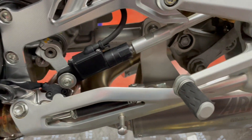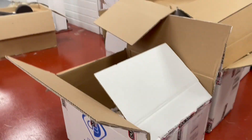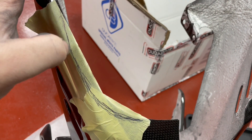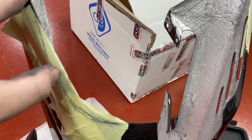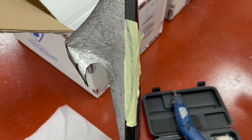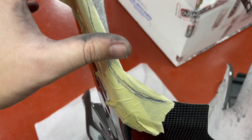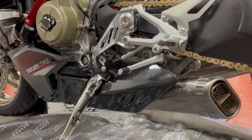We're going to attempt to fit it now — hopefully it'll go on nice and easy. Due to the position of the Zard exhaust, they come down lower and splay out further than the OEM. With the side of the belly pan, we're going to have to cut it down a bit more here because it's touching the exhaust and not allowing us to put the side stand down. So we're just going to Dremel that bit away, hopefully bringing the left side closer to the bike.